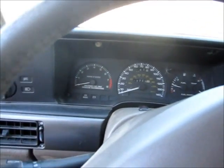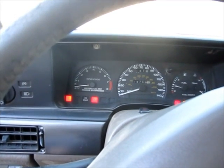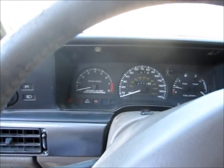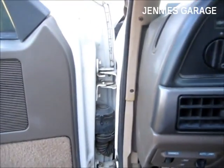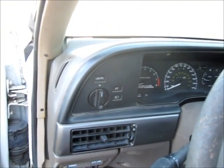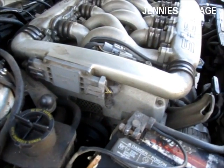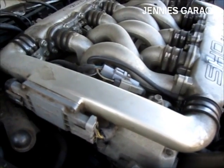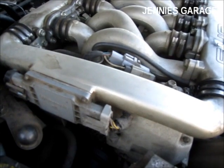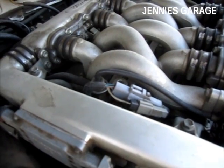Here's a demonstration of what it does. You turn the car on, the fuel pump comes on and everything, but no go. I've determined that there's no spark getting to the spark plugs. So today I'm going to replace the crankshaft position sensor and hopefully get my car back on the road. The crankshaft position sensor tells the computer when to fire the spark plugs and lets the computer know that the engine is actually turning, so if the sensor is not operating correctly, the engine won't run.